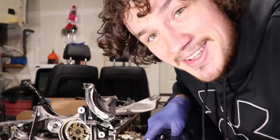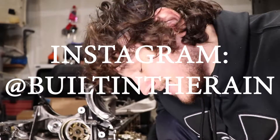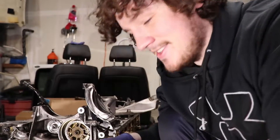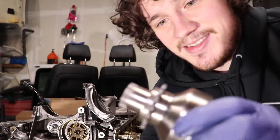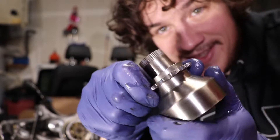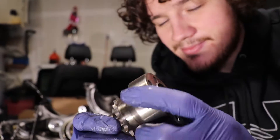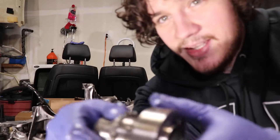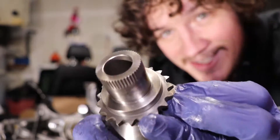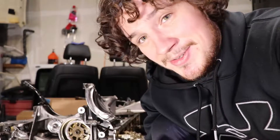And that's what happened to my motor. Luckily it didn't cause any damage and it's going to be reused. I'm going to use the donor motor I've been posting about on Instagram to be built instead. But I'm going to be installing this right here — this, along with that oil pump sprocket, is a one-piece solution; you can't separate these two. It will keep timing with the crankshaft and the camshaft, and to make sure it does so, it'll dig into the crankshaft with these splines right there.